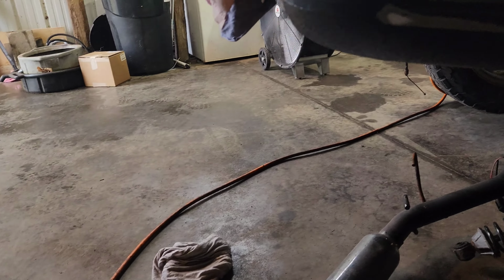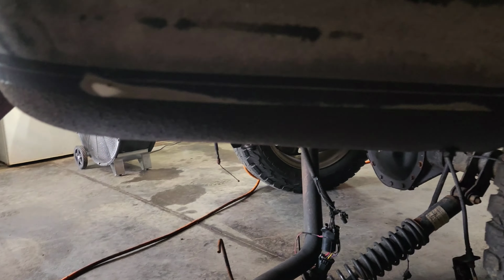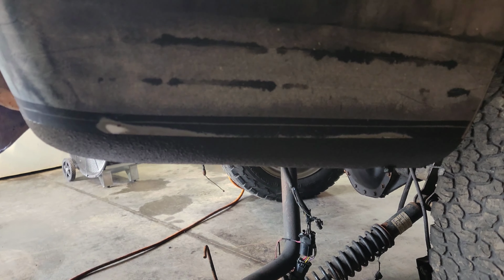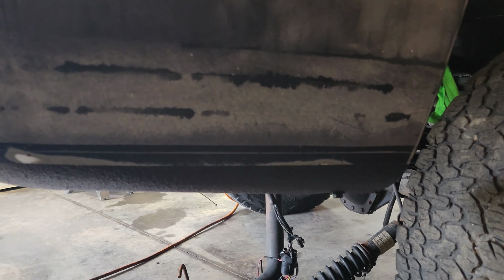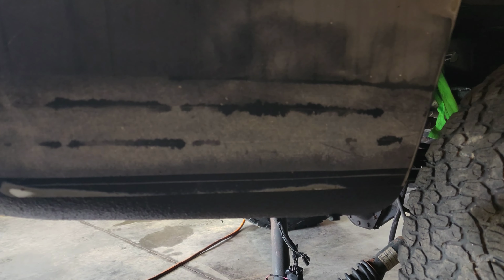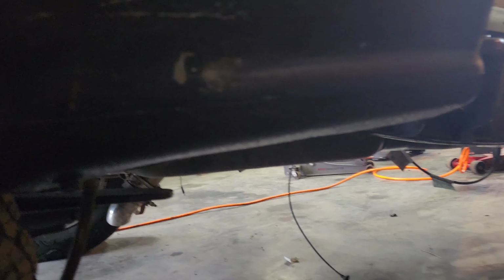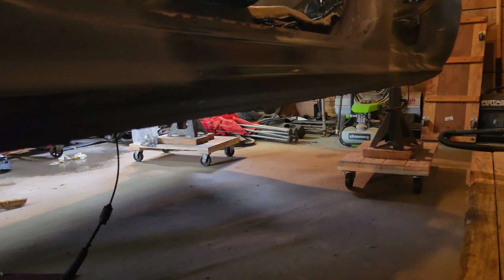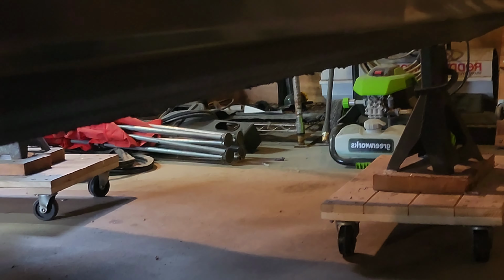And as I was saying earlier, now you can kind of understand, I put the texture there on the bottom, and then we'll prime over top of that and paint blue right over top of that. It'll just save it from rock chips getting up into the metal. So we got it there, and then the line transfers up to here, and then we got it just here on the bottom of this fender and here as well, and then it's all down the length of the cab here. Just helps out again with rock chips and stuff like that.